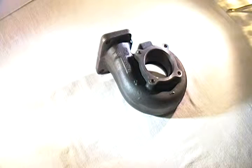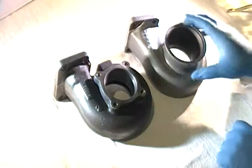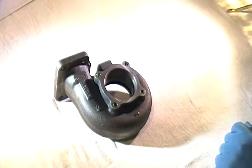The reason we find this a little troubling is that if they don't do it correctly, it's an automatic cause of an exhaust leak waiting to happen — that type of welding material is going to crack and cause an exhaust leak within the exhaust downpipe. This could cause intermittent problems with the car itself: unstable boost and other issues. So you want to be careful, because even though welding is less expensive than buying a whole new cast housing, you still want to stay cost effective.